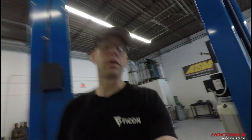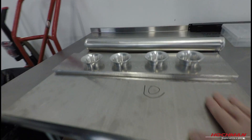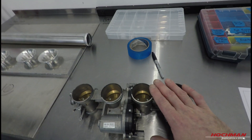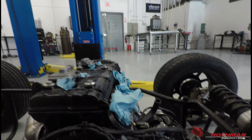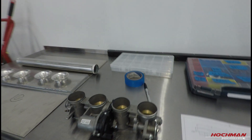Lots of exciting things coming, but to get things rolling here first, what we're going to be working on is the intake manifold for the Formula SAE car. We acquired a bunch of materials — some one-eighth inch aluminum along with some velocity stacks, and some quarter-inch and three-eighths thick pieces as well. We're going to figure out what we need to do in order to build a manifold out of this. The big thing that Jacob stressed, since he's basically building the body for this vehicle, was he really wants to keep it as low as possible — really low. That results in us having to scrap the whole idea of using couplers and clamps. This is new territory for me as well.